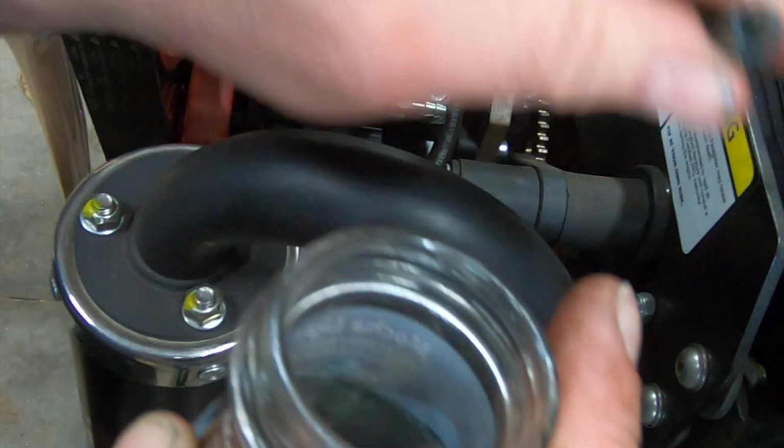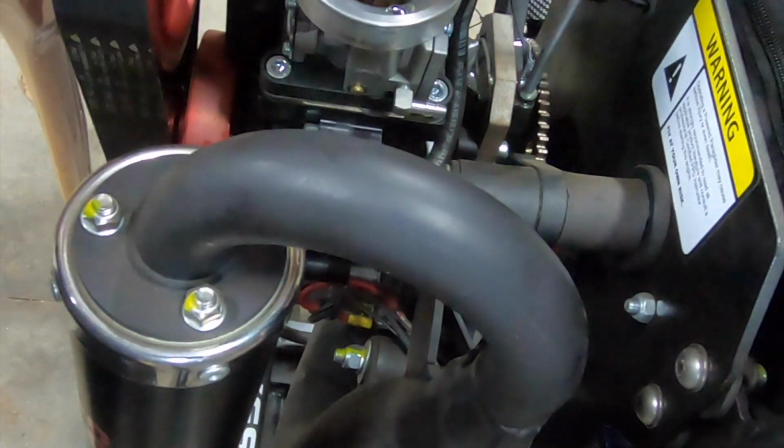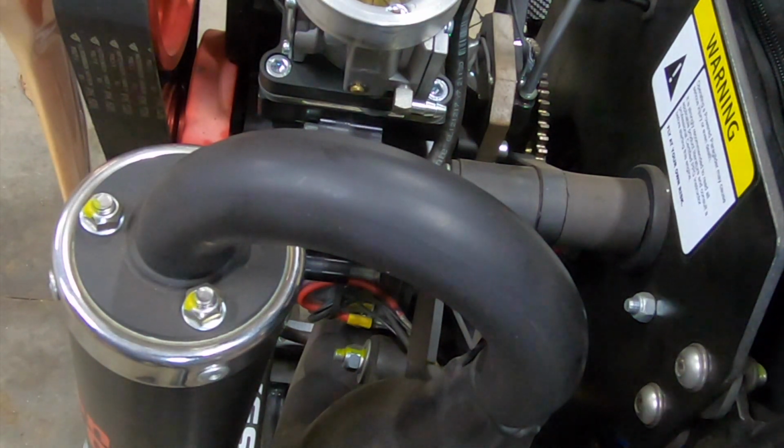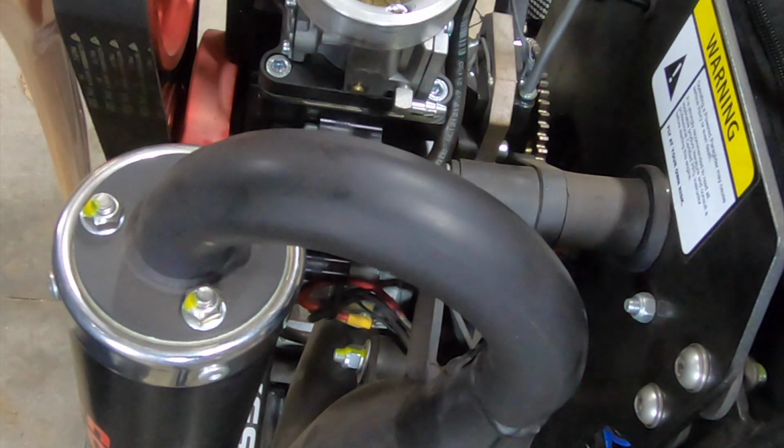See how it's turned a bronze color. This is urethane hose. It's about the best hose you can get for fuel resilience, I guess. Life with ethanol fuel. The ethanol kills everything, kills rubber. It's just corrosive, bad stuff. I don't know why they put it in that fuel. But, okay, we got that done.